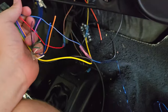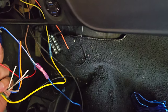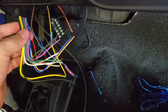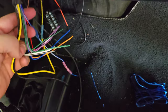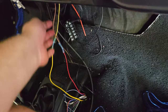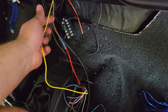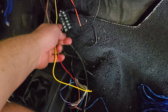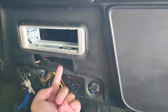The blue and white wire goes to the amplifier — this tells the amp to turn on whenever I turn the radio on. Yellow is solid power, red is ignition power, and black is obviously ground. Thankfully the auto wire kit for this truck that I installed a long time ago has the wires directly for it — tan is ignition, yellow is solid power. I have my ground strip for the other stuff I'm going to mount, it's loose right now but I'll install it up in there when I'm done.